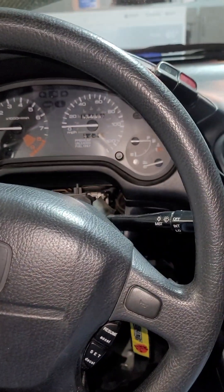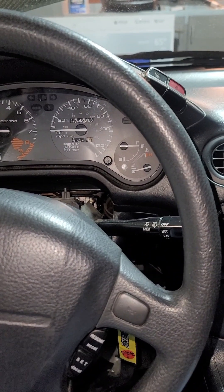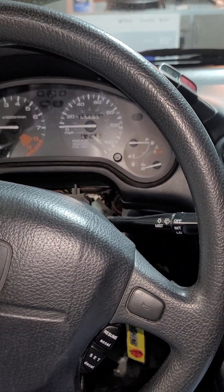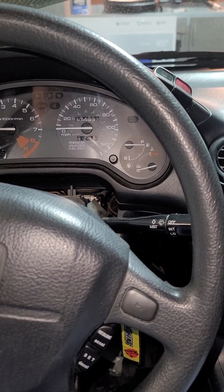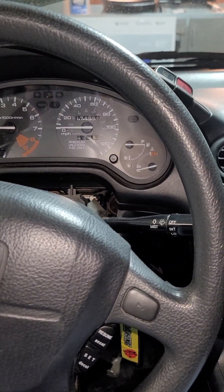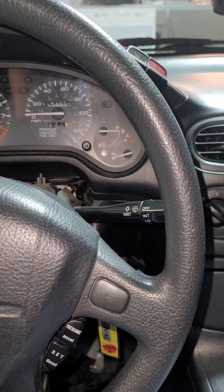From what I've read online, it's supposed to be the same wire as the Civic and Integra for comparable years, so I hope this helps. Then wire that to the ECU with some kind of ground trigger and just do a ground pass-through on the relay and you should be good to go.